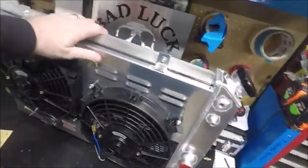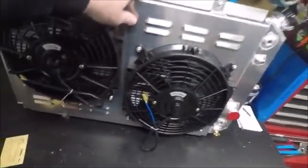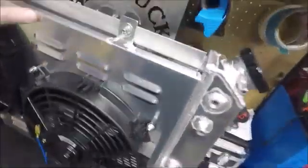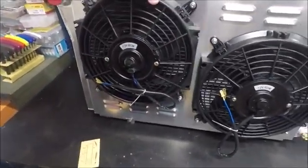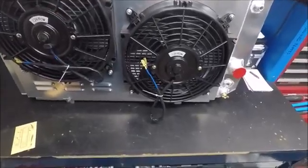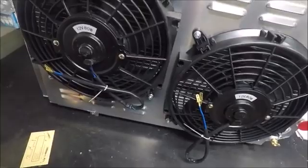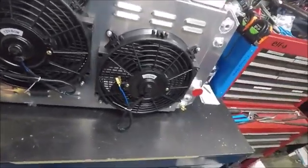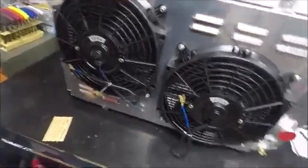It's pretty much like any all-aluminum racing radiator I've ever seen. The factory radiator I think is actually a two-core — this is a four-core. They also sell three-core radiators. I'll post a link to this radiator in the description. You've got this nice fan shroud with dual 10-inch fans. Nothing in their online ad tells you the CFM, but this blade design typically flows around 1,000 to 1,200 CFM each for 10-inch fans, so we're probably looking at around 2,000 to 2,500 CFM of flow from these fans overall.